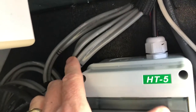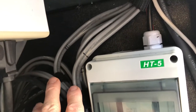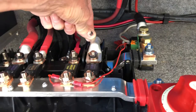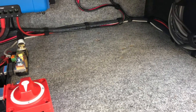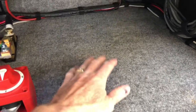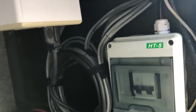I also ran three wires for 120 volts from the front of the coach circuit breaker panel, which I'm modifying as well. This is for future expansion when I add the inverter-charger. The inverter-charger will connect here where this 4-aught lug is, and will convert 12 volts DC up to 120 volts to power all of the coach appliances — things like the TV, microwave, coffee pot, vacuum cleaner, refrigerator, etc. It will install right here in the future.